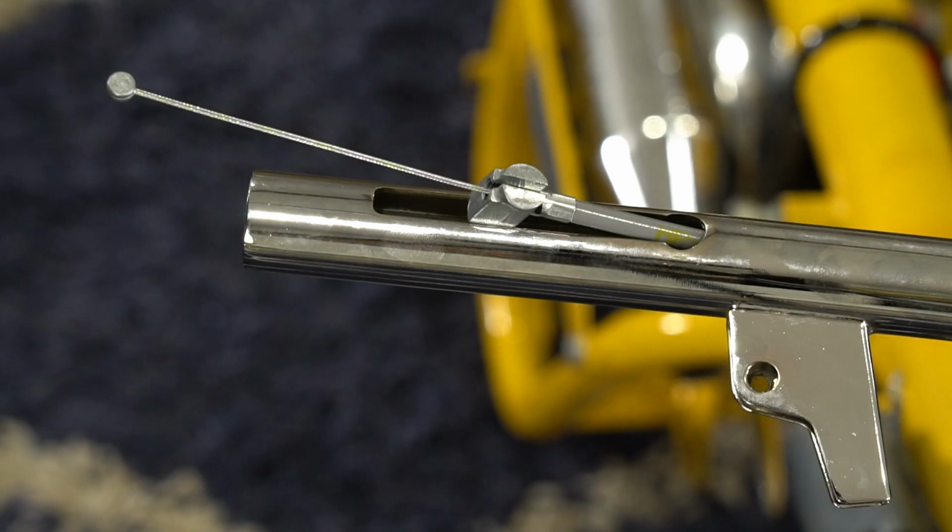So this is why I wanted to talk about free play real quick. So you're making some changes, big bore kit. Still want to run the stock throttle setup through the handlebars without switching it over to a twist throttle. But you end up having, in this situation, this is where this is helpful, if you have too much free play. What that ends up doing is have too much slack at the carb slide of your throttle cable, and you want to eat up some of that free play.